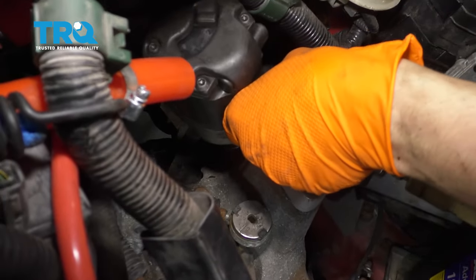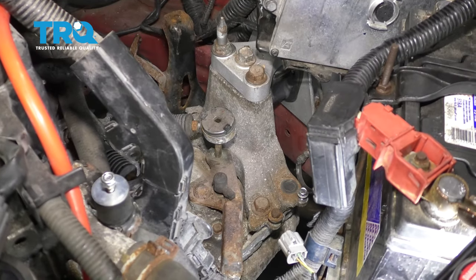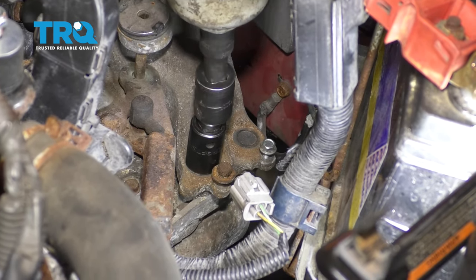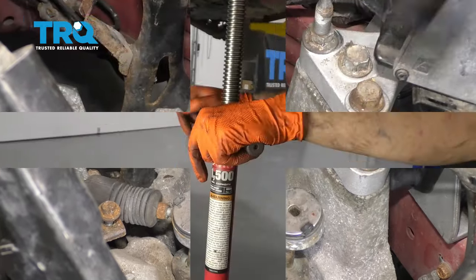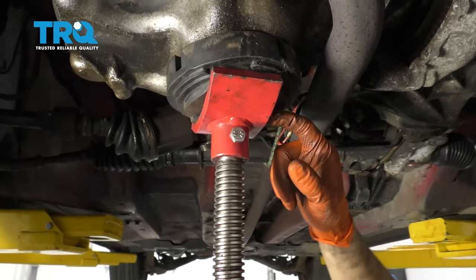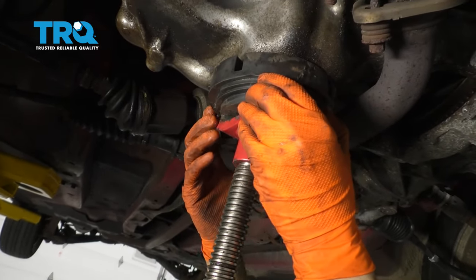It's tucked back there in the little crevice of this engine mount bracket, so it's hard to reach and hard to see. Since I'm up here, I'm going to break these free but won't remove them — just break them free so it's a little bit easier from underneath. I have a pole jack supporting the engine with a rubber pad — I don't want to put the steel plate right on the aluminum oil pan because there is a potential for it to get cracked. Either go on the sides with a wood block or put a pad to make sure it's nicely padded and properly supported.